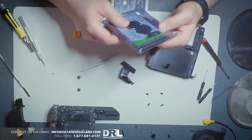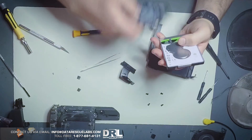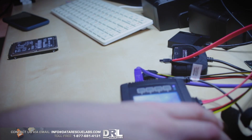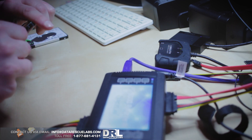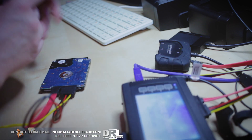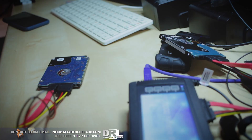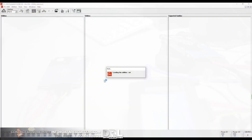Here's the new drive — let's open the package. Two drives total. Now let's move over to PC3000 so we can image these drives. We're going to take the original drive from the Mac and plug it into port 0 as our source drive, then take the target drive and plug it into port 1.